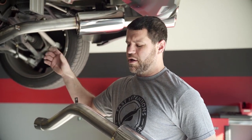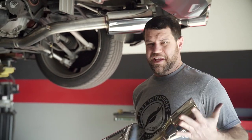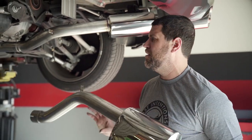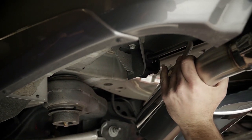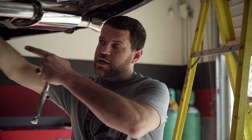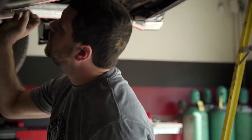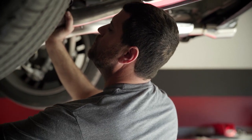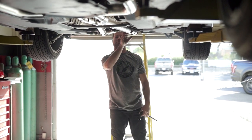Passenger side's tight — it's exactly where you want it to live. Now you're going to stick the driver's side on and repeat the same process. What you're going to want to do is try to line the in and the out up with this exhaust tip to match the other side. I'm at a point where I'm ready to tighten down the driver's side and match it to the passenger. I visually checked the in and the out from above and I really like what I've got. System's on — I'm happy with the way it looks, the way it fits. Everything's great, clearance is good.